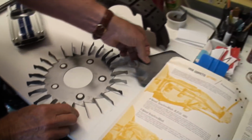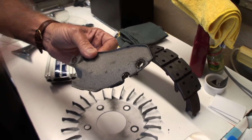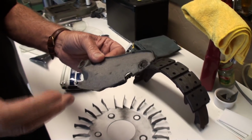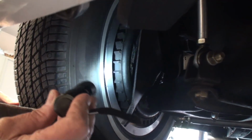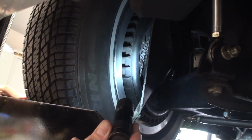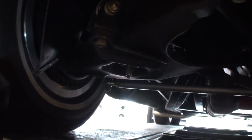And then the other part of this car also has the ducted brakes as well as the deflectors. They're called elephant ears in the front. They're big rubber Dumbo ears. Let's show those too. We've got the car up on the jack this time, just so you can see this. They're your Dumbo right there. Now you can see the fins on the drum as well as the wire mesh that keeps basically large debris from going into the brakes. Then it has corresponding cutouts in the back of this backing plate to exhaust all that.